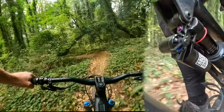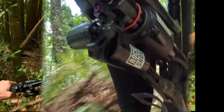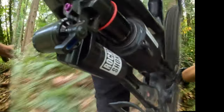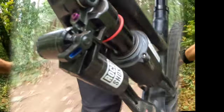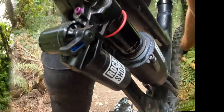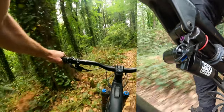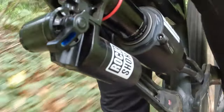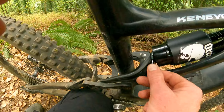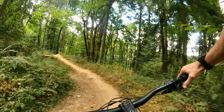First downhill on the Vivid — always a nail-biter, not sure if it's going to blow through the frame or not. I realized the Vivid is not a SuperDeluxe — it's not set-it-and-forget-it for five years. It's going to take some tuning. After running the same section about six times, I ended up with the rebound in the dead-slow position. I wish I'd just started at the slowest position and slowly cranked it up.